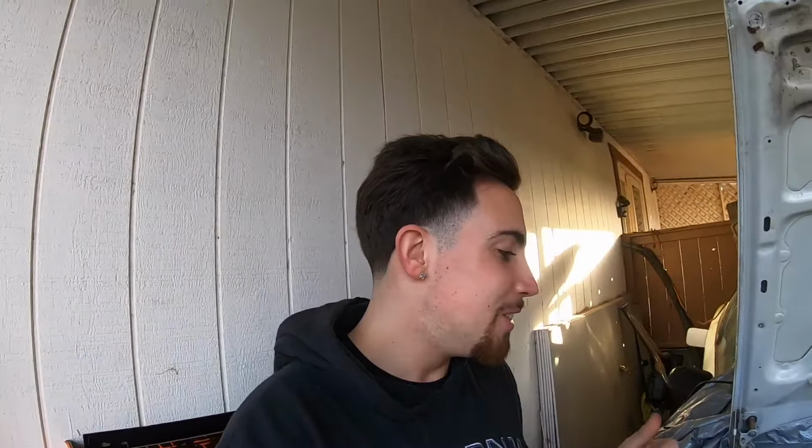The reason we were able to figure this out is because I ran my feed line straight from the hard line straight to the fuel rail and it started right up. This was yesterday. I haven't been vlogging the past two, three days that I've been working on the car, because I didn't want to just keep vlogging trial and error. I just wanted to go straight to when the car was good, not to waste your guys' time watching the video. But once we figured that out, I ordered the Audi pressure regulator, put it on, fired right up, and the car is now good.